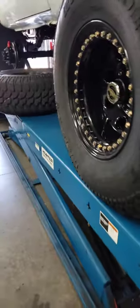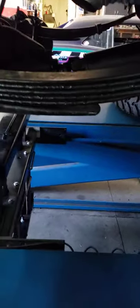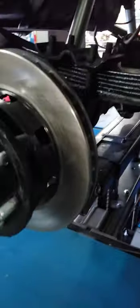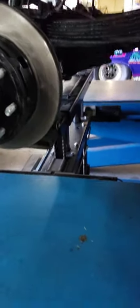The motor runs great. I'm going to make another video so you can hear how it sounds — it's got single-chamber Summit chambered mufflers on it, a dual two-and-a-half inch system that dumps right before the rear axle. That's temporary — I don't like smelling the exhaust either. I'm going to put tailpipes that go out the back but dump before the rear bumper, because if you dump them out the back, all the exhaust gets sucked through the back window. Also, I made a mistake and need to do rear axle hub seals because the old ones are starting to leak gear oil onto my brand-new brakes, which I definitely don't want.